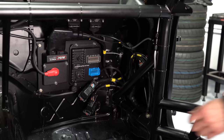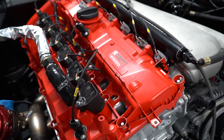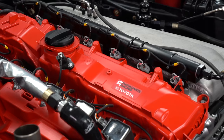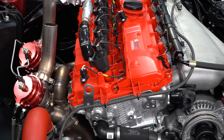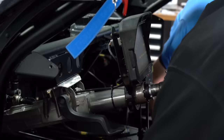The heart of the electronics is the AEM Infinity ECU that we're using. This ECU — engine control unit — is specifically designed for motorsports electronics. It brings in all of the sensor data: temperatures, boost level, engine RPM, and then outputs to the proper injector opening time so it gets the right amount of fuel, and when to spark the coils so the spark is at the right time. All of that is programmable on a laptop that the user can tune.